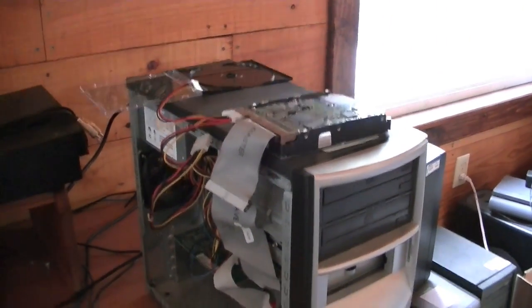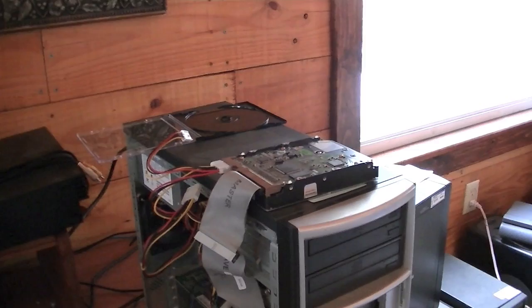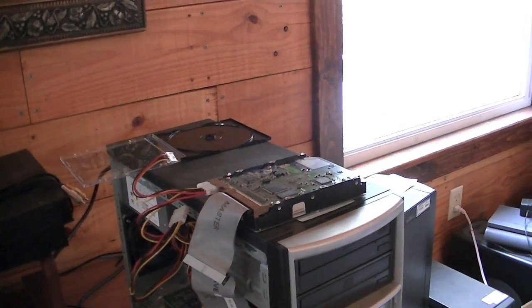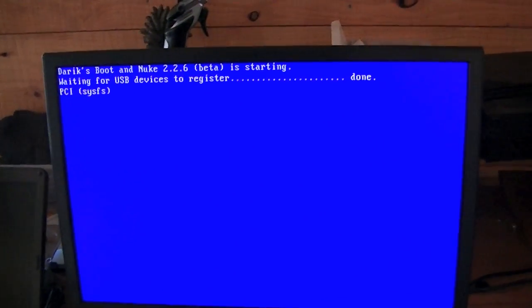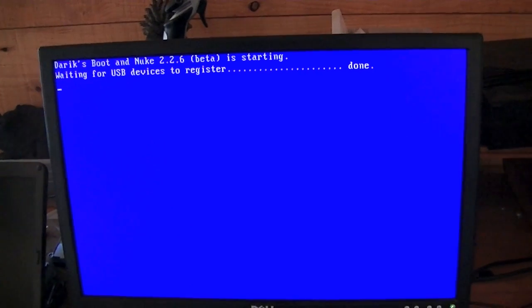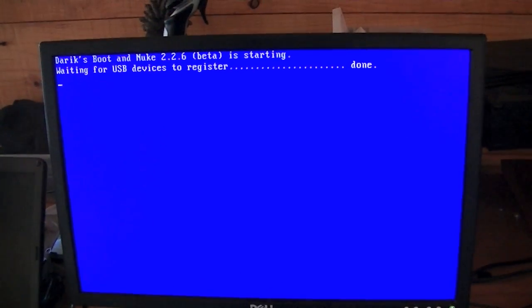Keep in mind that this does take a very long time depending on the size of the hard drive. Hard drives that are about 40GB, which are very small, usually take about an hour. Anything larger, like a 500GB drive, might take up to 20 hours of wiping to destroy the data. But it does destroy all the data, so you really don't have to worry about anyone stealing your data off your drives.